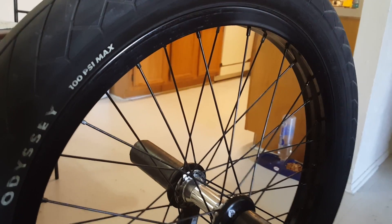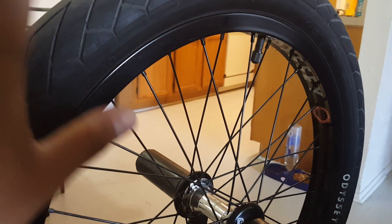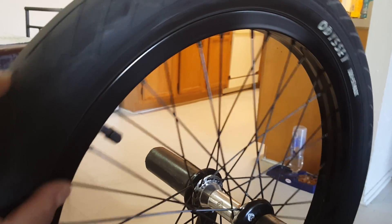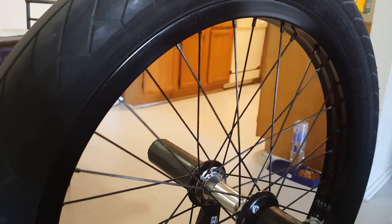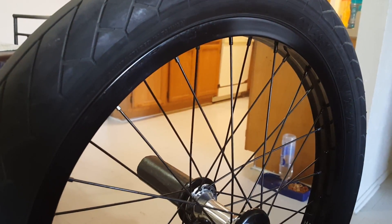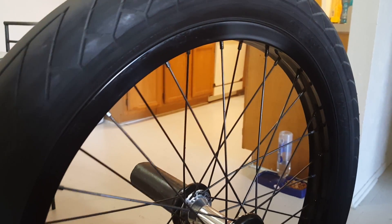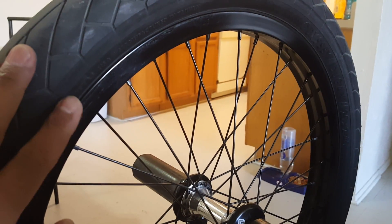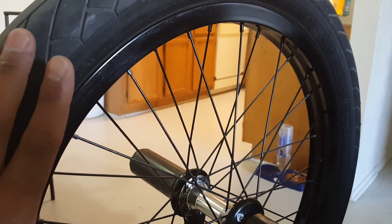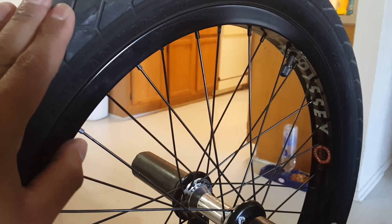The first thing you should do before taking off your wheels is clean the sidewalls. They're not that dirty because I just wiped it down, but I am going to put it on a stand. You want to clean your rims off because if you have sand on it when you're using it on the stand, you might scrape your rim. Also, dirt can cause the stand arms to get stuck and lift and rub, and you might think your rim's not centered when it's actually just dirt.